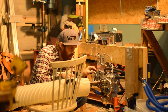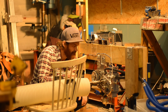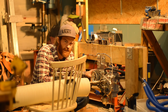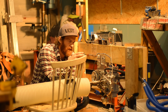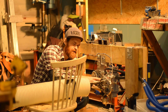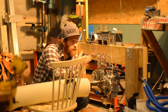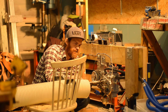Welcome back to my garage. Today we will start the brute force concept engine again after replacing the leaky 3D printed parts and reducing the drive ratio to a little bit over 2 to 1 — increasing it so the crank has to do about 2.2 turns for the blower to do one turn. That's a 2.2 to 1 reduction. In the previous video I said I was going to wait for better weather and do this outside to not set my garage on fire.